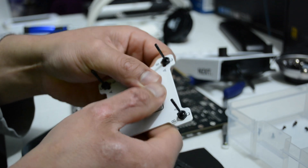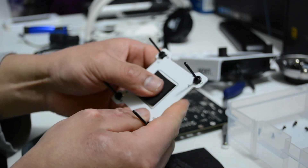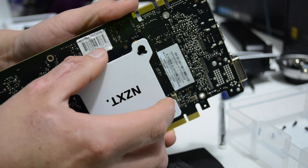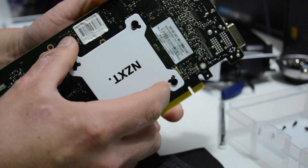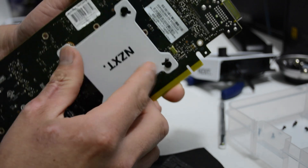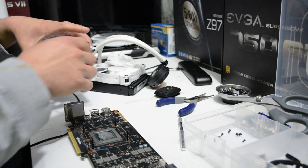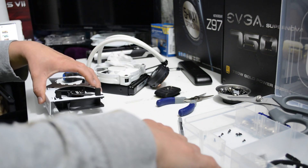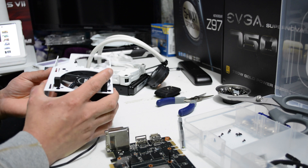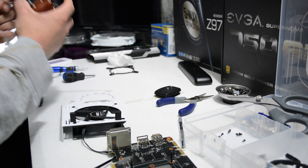Let's get ready to install the backplate to the PCB of this graphics card. It's time to install the NZXT Kraken G10. Put in the NZXT backplate on the back PCB of this graphics card — carefully introduce the screws and do not force them; they should go in easily, like a hot knife on butter. If you follow the steps you are good to go. After this it's simple and easy.